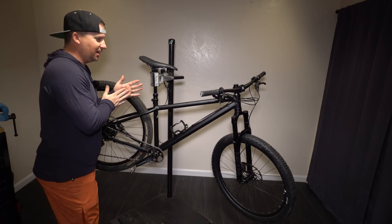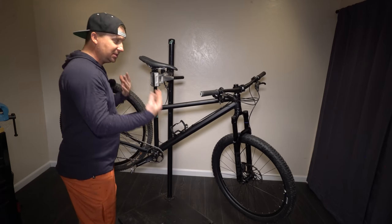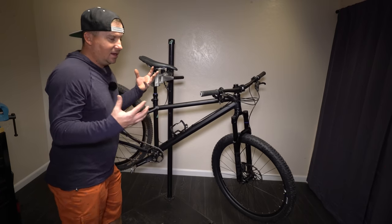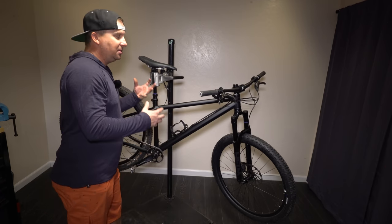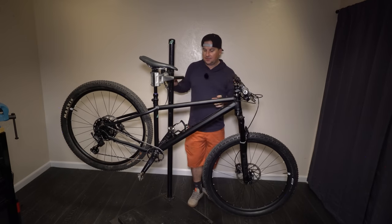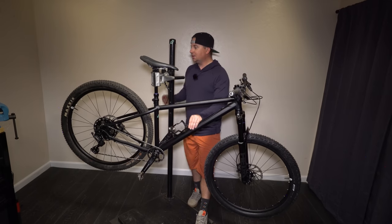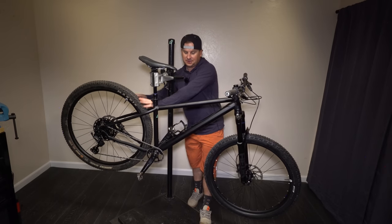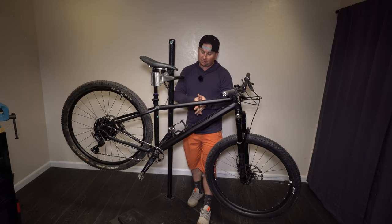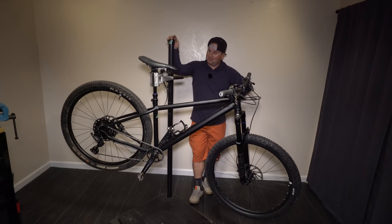I'm really excited to ride this bike. When it came out I was like, finally — it's like somebody watched my 'what does the future of hardtails look like' video where we talked about 65-degree head angles on 120 to 130mm bikes that are still light and zippy and retain that amazing hardtail character without feeling twitchy like an XC race bike. I think we're going to see a lot more bikes in these geometry numbers going forward. One more thing: this has the same problem as my Banshee Paradox — when you put a water bottle on, it wants to pinch the cables. I ran a nut from a valve stem as a spacer under each bolt, and it lifted it just enough. A little hack if you have a similar bike that routes cables on top of the down tube near the water bottle mount.